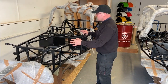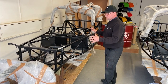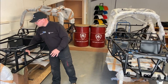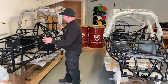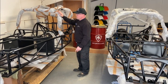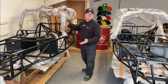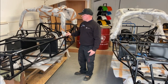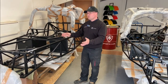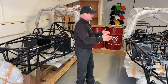It's square tube right the way through. All the bracing and everything we do on this particular chassis is no different to the RR — we don't change anything in terms of structural things on the rear or front end of the car. You have a cage option of 50mm or 38mm inboard with side impact bars, or just a roll bar and cross brace roll bar on the back. That's the Indy R — square tube chassis, really developed for about 50/50 road and track use.